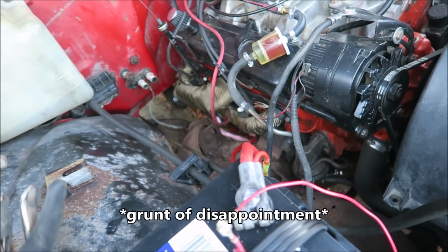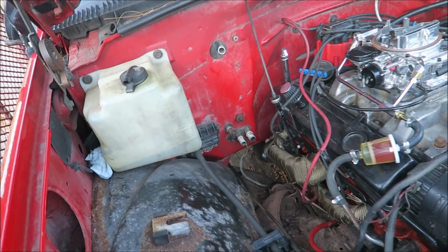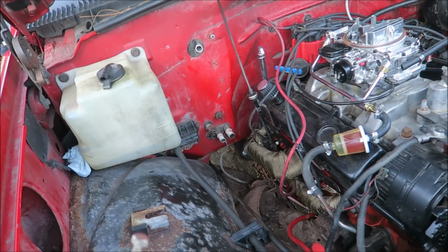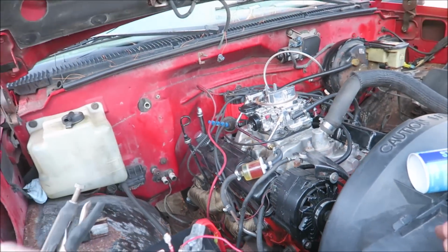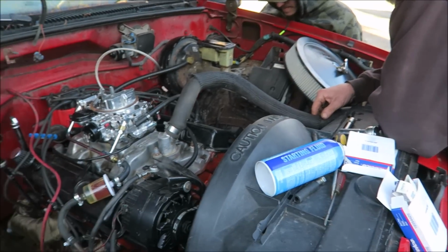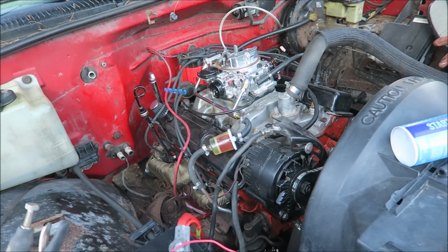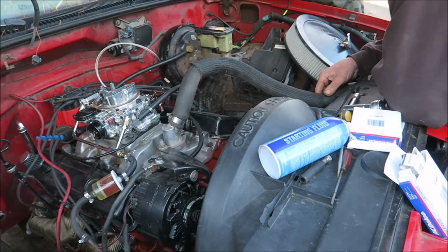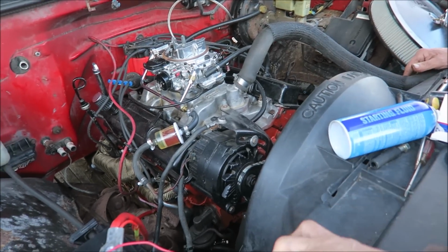Oh, you didn't put antifreeze in it? Meant to, and never did. That's creamy. Yep. You might toast the motor. Flush. This has got just pure water in it, right? Yeah. You might want to just flush the oil all out, put new in it, change the water.